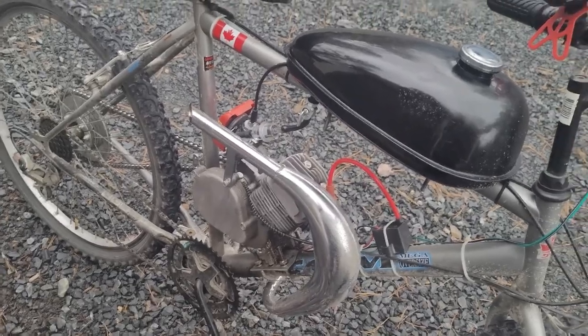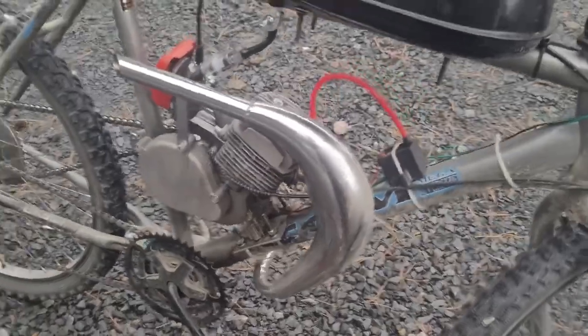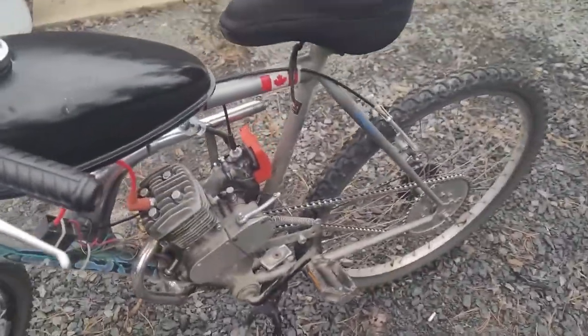I haven't talked much about the spring chain tensioners that have been used on a few of the builds in this audit. You can see he's using one on this build. It's important to note that not all frames complement the spring tensioner. Some don't have room for it. If you have a trail or mountain bike setup where the rear tire is really close to the seat tube, you usually can't get away with using the spring tensioner.